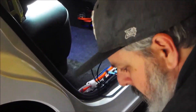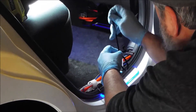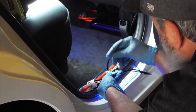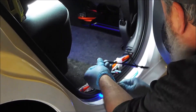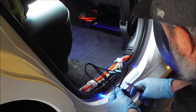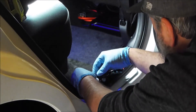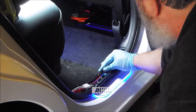Next step, we're going to take this wire and a tie strap. We're going to put one tie strap here, then take one more tie strap and put it here — make sure we even out the wiring. Once we've done that, take some clippers and just clip off the extra. Then take the excess and where you have your wire loom, stick this down into the housing so it latches — and all your wires are tucked nicely away. Easy peasy, just like that.